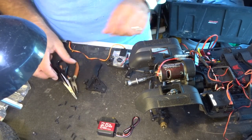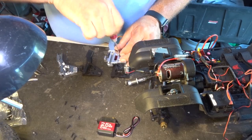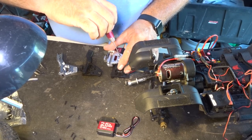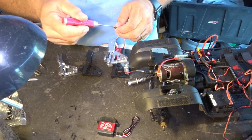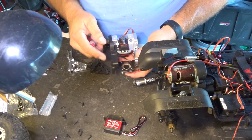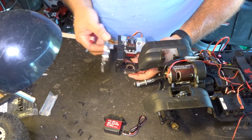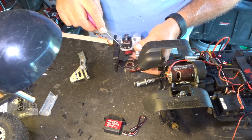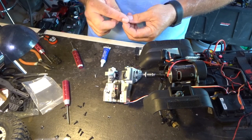So I've got that side off. Now we're just going to take off the panhard. We'll be right back. So we've got one side completed, one side needs to be done. We'll be replacing this with this - we just got to take these 2 screws out of this bridge and 2 screws out of what would have been the servo unit spot for the servo originally. And it's stripped out.